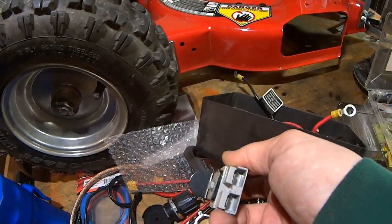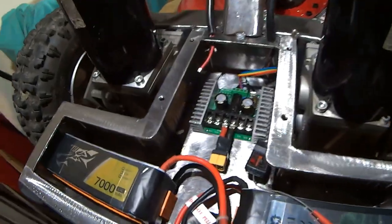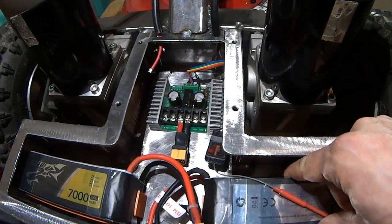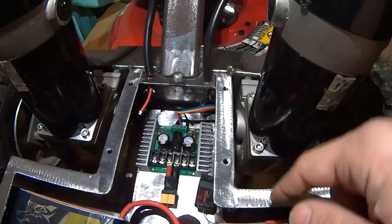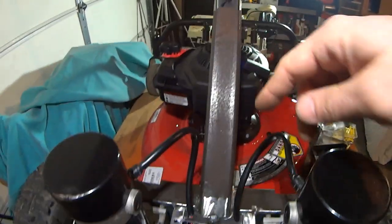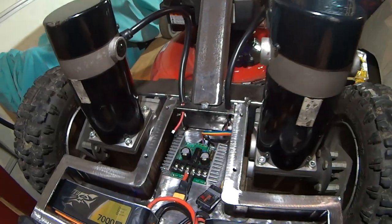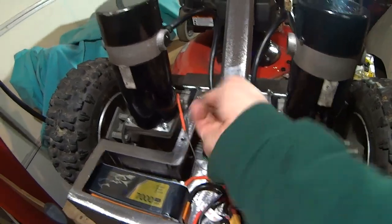I was looking at these sweet SB connectors - these things are awesome. I may use those, but I don't know if we've got enough space in here. Check out the layout: the battery holders are going to get double-sided taped down when we're done painting in here. It's important to note that the motor controller I want direct mounted to the metal chassis - it's basically a heat sink and I want it direct connected to this platform. The antenna is actually going to get remote mounted somewhere up in the top tube because I don't want it down here between these two magnetic fields in a metal enclosure.